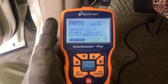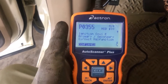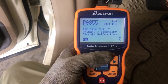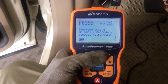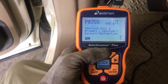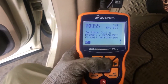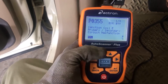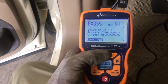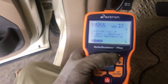Hello everyone. Today we have a 2007 Ford Edge. My wife was driving it and she said that whenever she went to hit the gas while driving, it kind of shuddered and shook a little bit. I plugged it in, pulled the codes, the check engine light came on after it shuddered, and I'm getting this P0355 — ignition coil E — a couple pending, a couple confirmed.